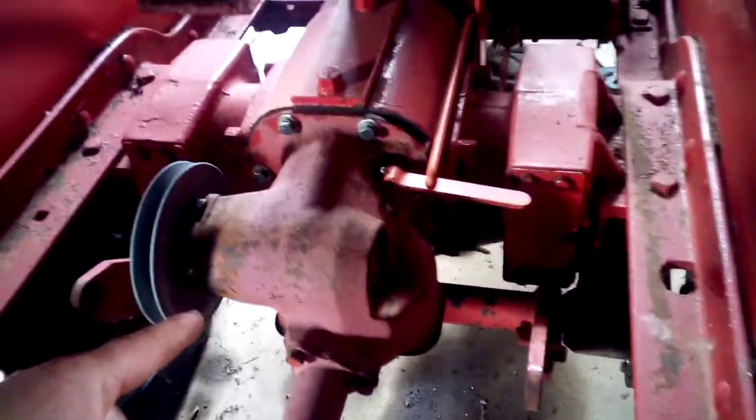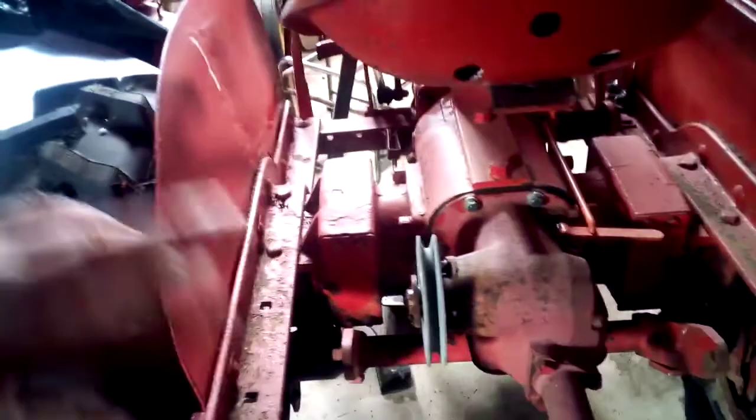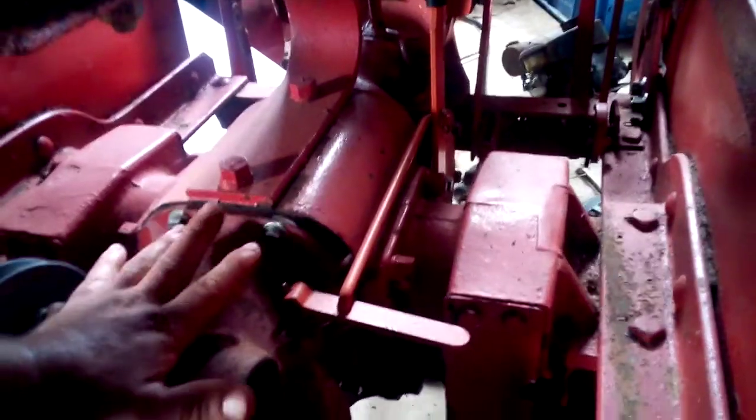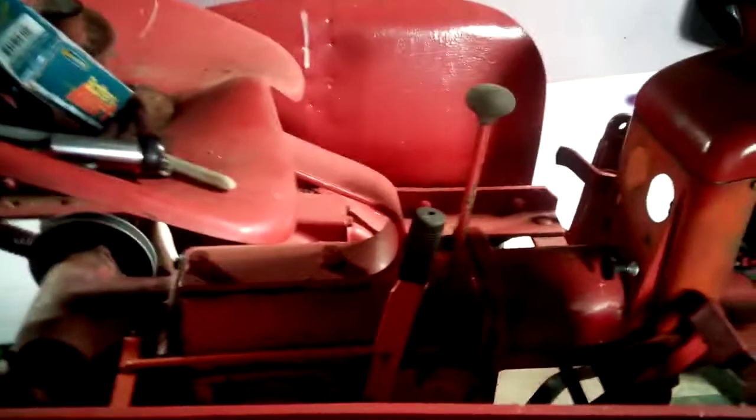these boxes here, these are already rebuilt. New bearings and seals. The transmission input bearing was just blown apart. And what's really bad is the bearing in here that the PTO shaft slips into, which when I got the machine, it didn't have a PTO. It just had the cap. So the fact that that rear bearing was completely destroyed was a little surprising. So anyway, that's all rebuilt.